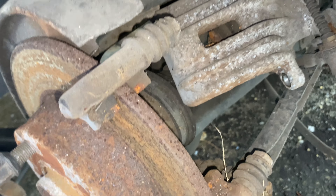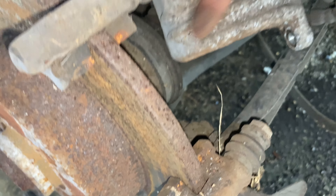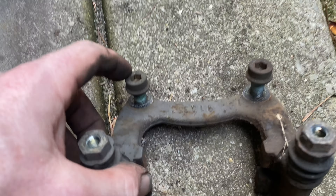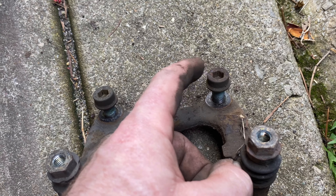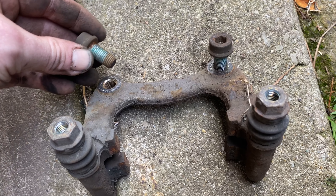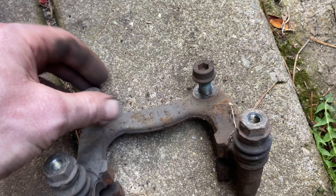From the side you can follow the leg of the brace down and find the bolt, then follow the other leg down and find the second bolt. This piece faces away from you — the rotor's in the middle — and remember you took the two 13mm bolts off to get the caliper out. The two Allen bolts are underneath. Back them out, slide the brace off, and put the bolts back in the same holes so you know where they are. If your rotor is rusted on like this one, hit it with a hammer to get it off; otherwise it'll just fall right off. That's the end of the process if you're only doing pads and rotors.